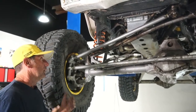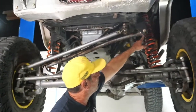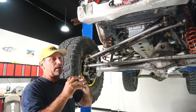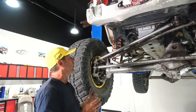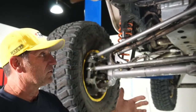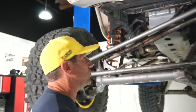I start looking around at welds to make sure I don't see anything cracked. I haven't cleaned the jeep purposely — a crack will start to gather dust, which makes it really easy to see. I'm looking on the bottom of the bumps, the shock towers, motor mounts, all the axle brackets all the way around. I'm also looking at the ball joint deletes I freshened up, checking whether anything looks like it settled or got loose.